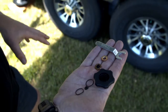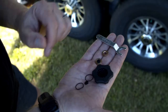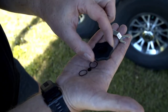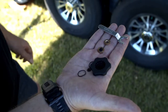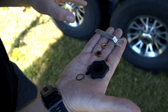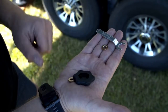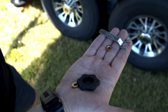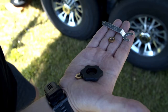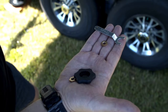The little rubber seals — the large ones and the small ones — are just required as spare parts on the actual TPMS. Don't need to worry about those at the moment. You might be wondering what this big lid contraption is — this is an unlocking device, which I'll show you in the troubleshooting section on how to take the top off the TPMS when it's in your hand, not installed on the wheel, and actually change the battery out.